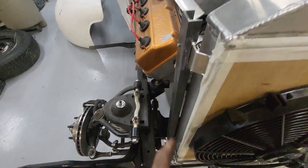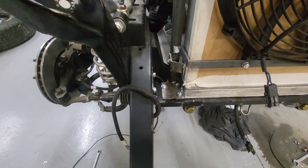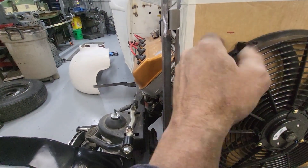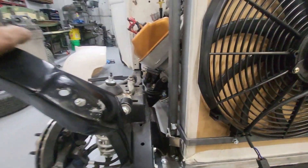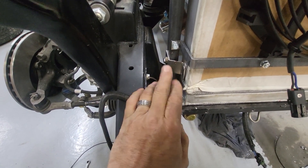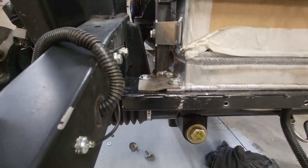On the bottom I'm on the outside, so I basically built two towers. I put weld nuts in on the back side — this one bolts in this way, this one bolts in that way — using the original holes. Then I came down and fabricated a base for it, welded on the c-channel, and stepped it an eighth of an inch to go over the top of the aluminum on the radiator mounting flange.